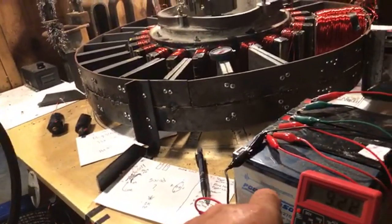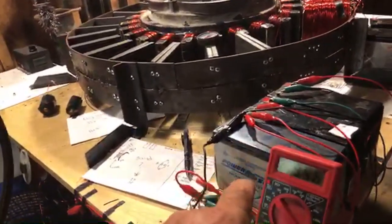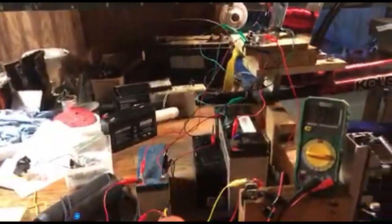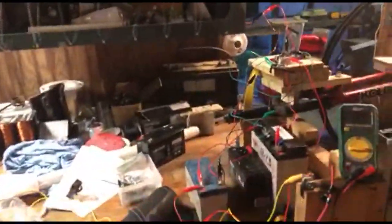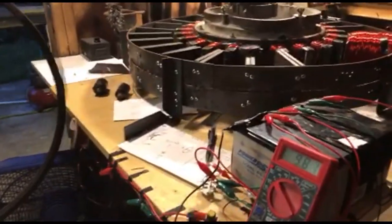And what it's doing on the plates, they get all crusted up with the electrolysis that goes on between the plates, and it gets cluttered up through time, and it kills the battery. Yep, these are both dead batteries we're charging. So we're literally desulfating both of these batteries. I got a bunch of batteries, some are dead, some are good. And these were dead ones. So this is a great way to check the theory on desulfating. So these are definitely both hitting it. So now the wheel's getting hit from two sides.